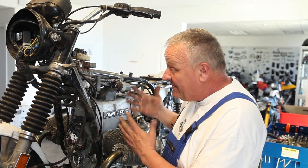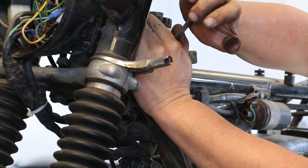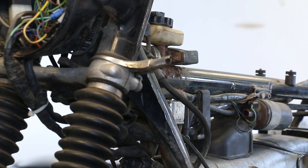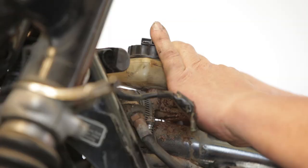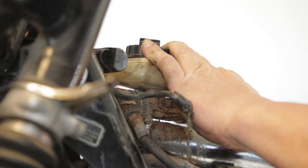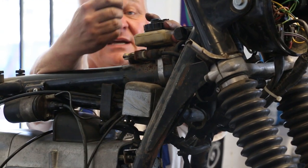We'll have a look at it and see if it can be salvaged. First thing to do is loosen the brake line while it's still attached to the frame, so hopefully it comes loose — yeah, good. Don't need to take it off all the way, just loose. We can just unplug these wires. I got to disconnect the cable next; it seems like it's frozen, but I can just tap it — oh yeah, lightly frozen. I can disconnect the cable and take the little barrel out.